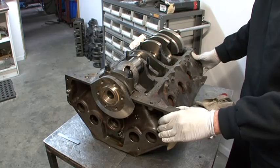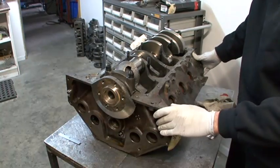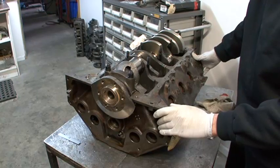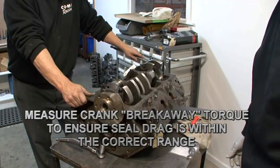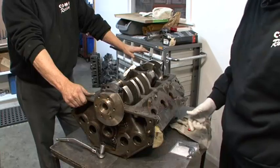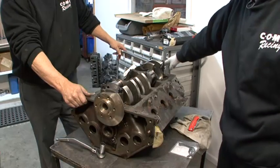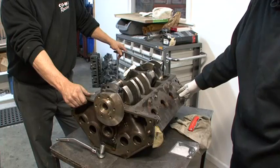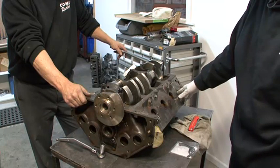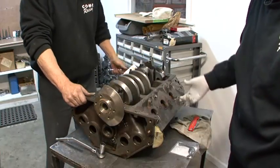That's basically it — this seal will not leak. When you first start this engine, you'll get a little bit of the molly thrown out behind the crank flange. Don't worry, that's all that's coming out of it. With the crank in place, verify that the seal hasn't constricted the movement of the crank too much. You can use a torque wrench to check — you need a spec of no less than 10 foot-pounds, ideally around 20 foot-pounds, and a maximum of 25 foot-pounds resistance to turn. Check it — it's not hard to do.